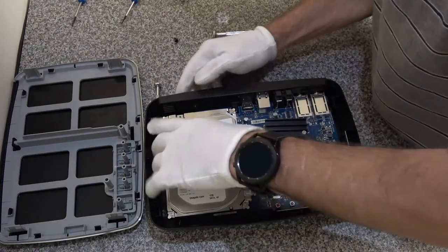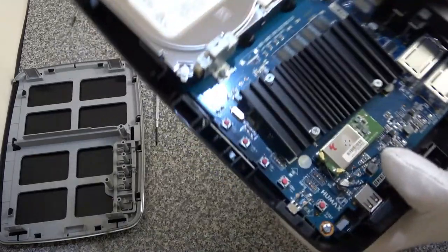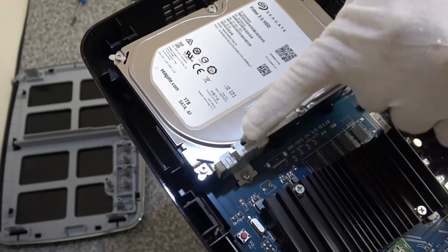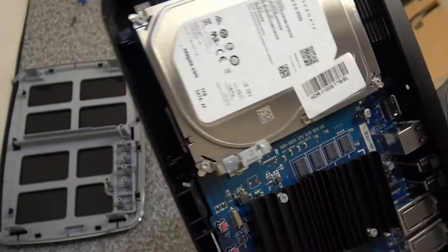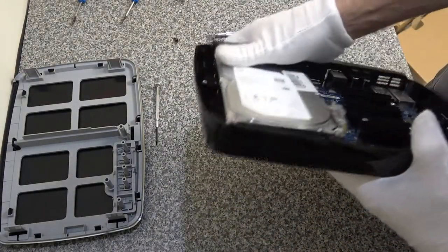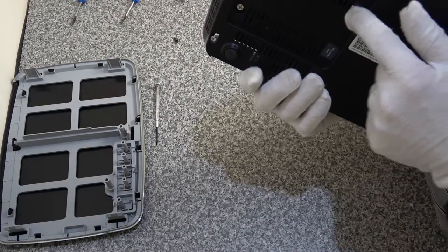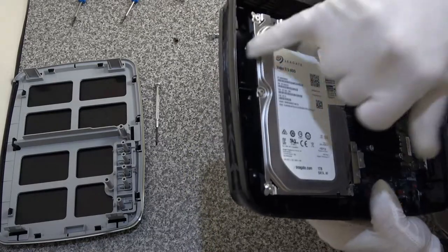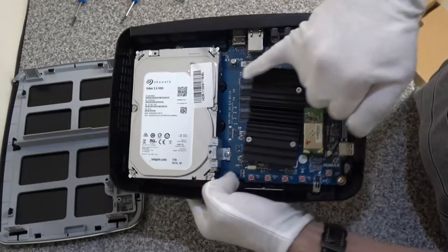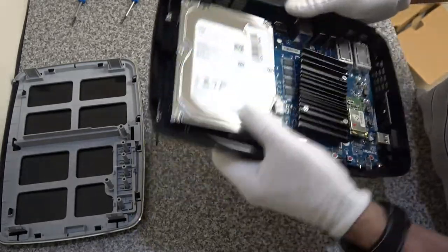Let's have a look to see how that disc is mounted. There's a bracket here - the only bracket I can see. There's a screw there holding a bracket, and I can't see any other mount points apart from underneath with two screws. I know there are four screws total, so you're going to have to remove these warranty seals as well and remove those two screws, which you can see are here and here, and then underneath they'll be here and here. That bracket needs to come off as well.